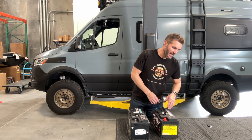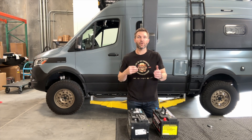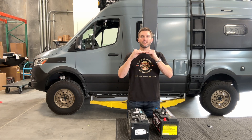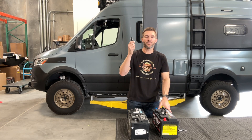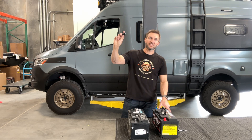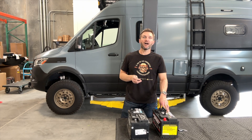This battery gets around ever having to plug the van into a trickle charger or worry about it going dead. When this battery reaches a certain percentage of its overall charge due to parasitic drain, it will shut off and disconnect the battery from the chassis — with about six engine starts left in reserve. It's called an Anti-Gravity battery, and each one comes with two remotes. You throw one in your van or on your keychain. If the van has been sitting in storage for four months, you click the button once, and that releases access to the remaining charge — giving you about six starts.